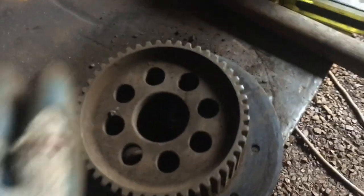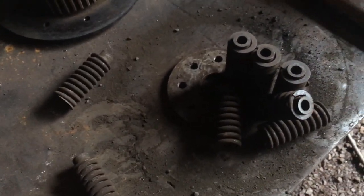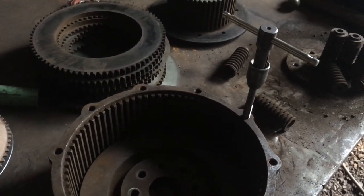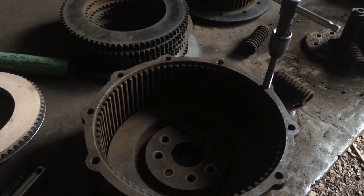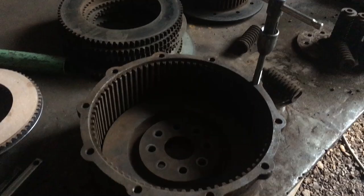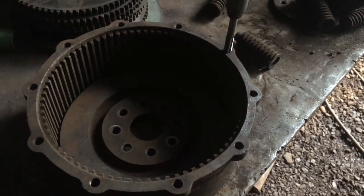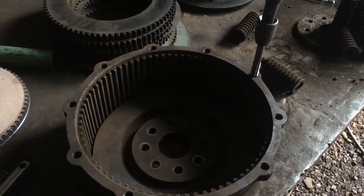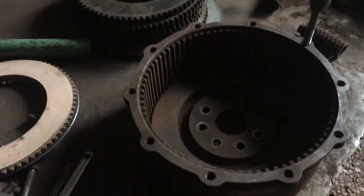As you dump in here and lift this up, you see a whole bunch of springs and they all just kind of fall apart. All this needs to get wire-brushed. What I'm going to do next is show you another step I do on all my projects — especially on a rusty piece like this. I'll chase the threads with a tap, going through each one of these bolt holes and re-threading them just to make sure the threads are nice and clean. It aids in making things go back together with no problems. I do that all the time on rusty bits and I highly encourage you to do the same.